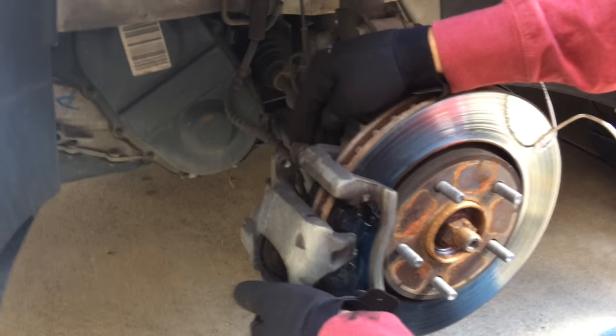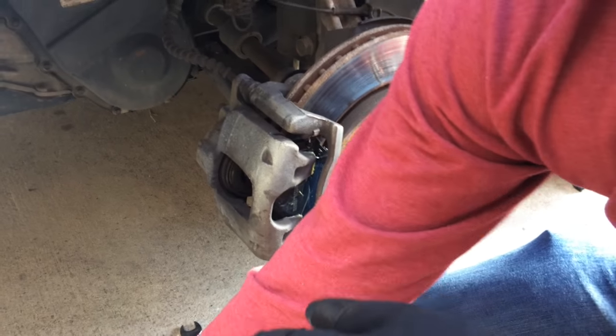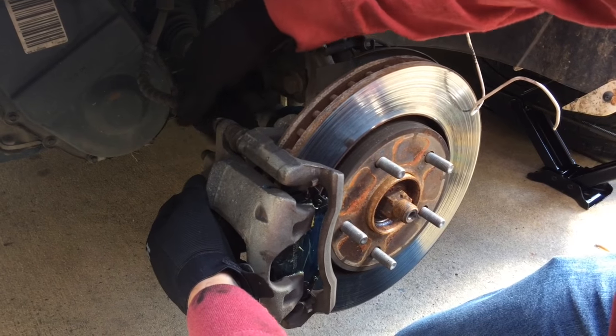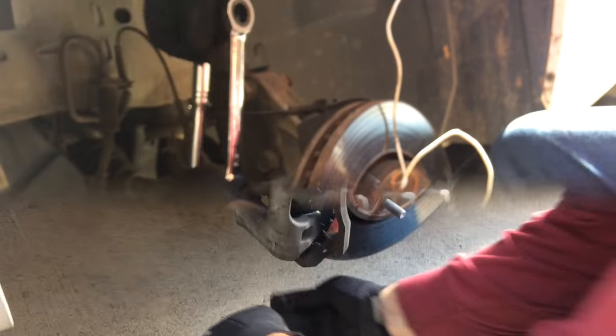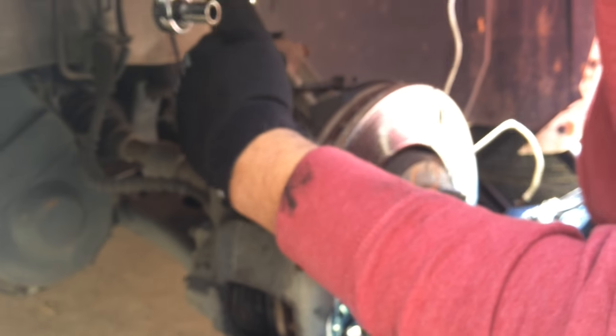These compress a little bit — slide them in and get it back up to where you need it. These bolts have Loctite on them; I do have Loctite but it's put away, so I'm going to go without. Hand-tighten first, get both of them in, then tighten them down. I think this is around 30 foot-pounds of torque. I wish I had my torque wrench handy but I don't. Tighten it up and finish tightening — then we'll put the wheel back on and go to the other side.